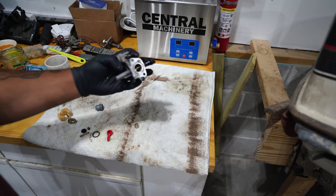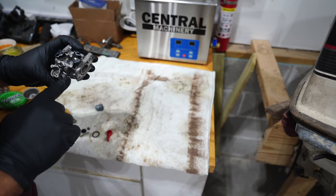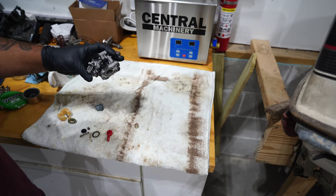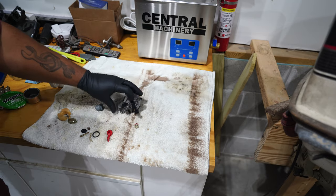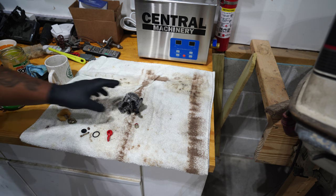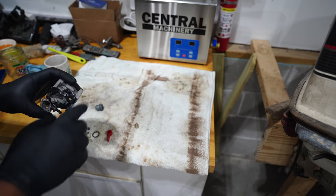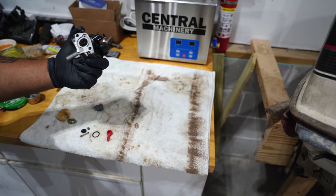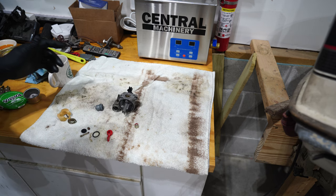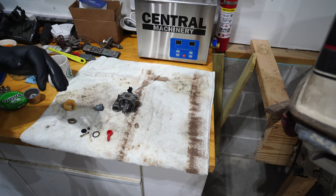Took a bit of extra love to get this thing unclogged. It took me quite a while, actually. I had to soak this. I had to keep digging at it and soaking this in order to get it clear finally, which it is now. I think if I had left this sitting overnight in just carb cleaner or used pure carb cleaner like I normally do, it would be fine. Problem was I couldn't get all this plastic stuff off of here, and you really shouldn't soak plastic and rubber in carb cleaner, so we had to go about it the long way, but that's okay. It's good now. So I'm gonna start putting it back together and then get it back on to the machine